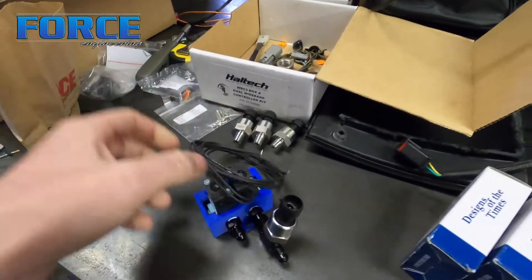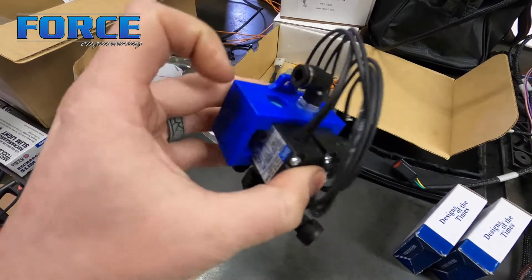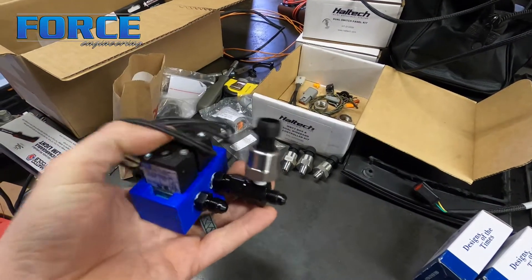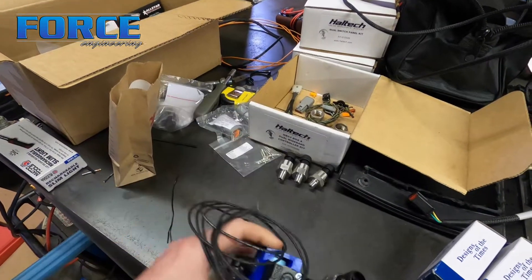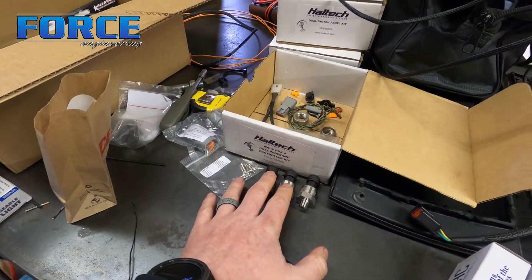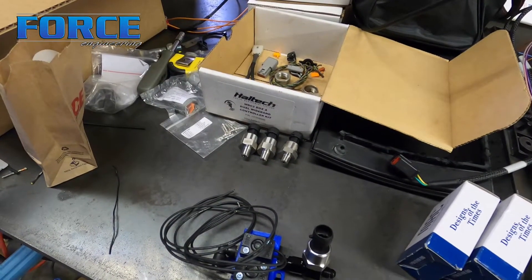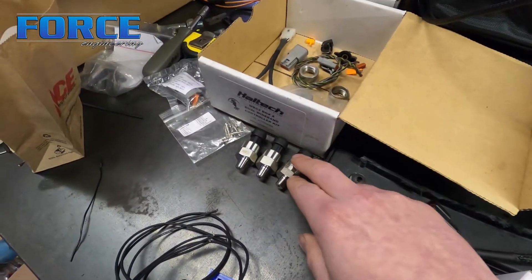This is what this looks like with all the fittings in it. CO2 in here, just a vent there — I should probably put one of those stone filters on but I don't have one. I have the pressure sensor here for monitoring wastegate dome pressure, so pretty compact setup. I got a couple 300 PSI pressure sensors for transmission line pressure and converter pressure, and then this other one's going to be back pressure — exhaust back pressure sensor, drive pressure sensor, whatever everybody calls it.